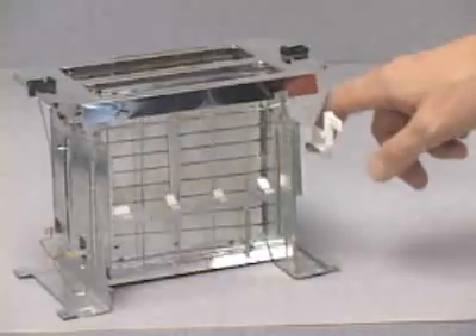This is not a complicated device. If you plug it in, it will get hot. If you had two of these, you had the basics of a toaster, but there's no easy way to get the bread out without an ejector. The ejector is a little spring-loaded tray that moves up and down. What you need is something that will keep it down long enough for the bread to toast.